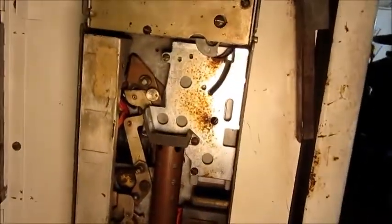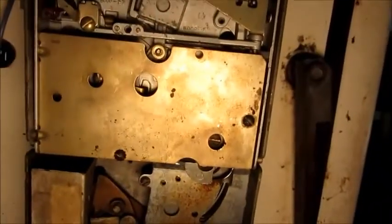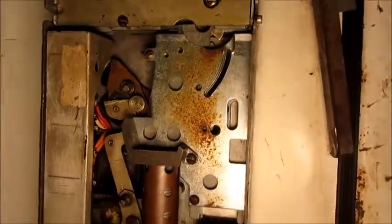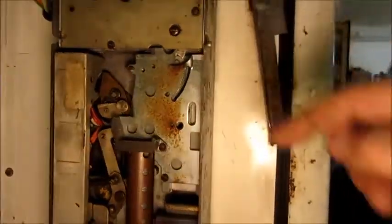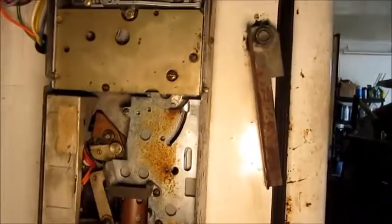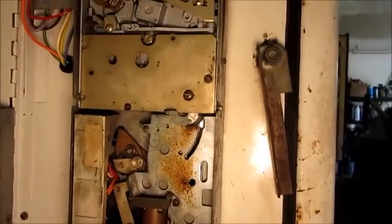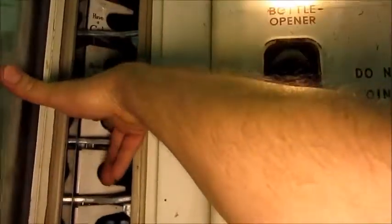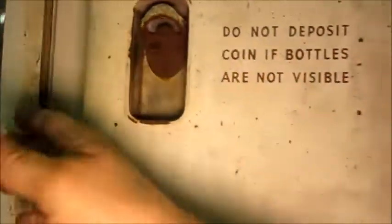It can also accept nickels. It would take two nickels to add up to 10 cents. The nickel part of it is purely mechanical. There's a mechanism in here that flips back and forth every time a nickel goes through. I'll put in one nickel — you can watch it fall through right in there. It went this way right into the nickel holder; it didn't go through the track. In this little track there's a micro switch — when it hits the switch it unlocks the bottle rack. So the second nickel will go in and you'll see it'll go through this track and unlock everything. You see it unlocked — now we have the 'Have a Coke' light. I'll pretend I'm pulling out a drink and lock it back.